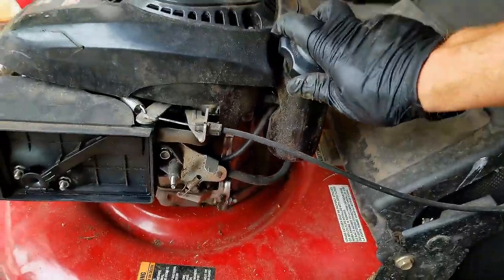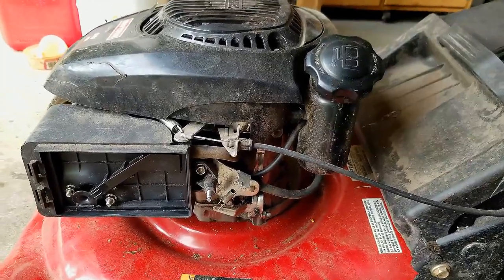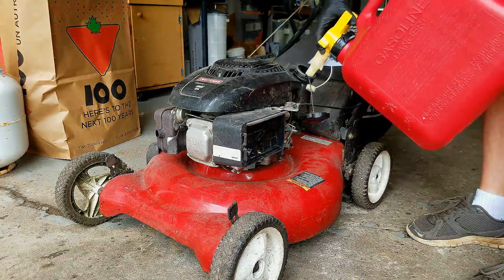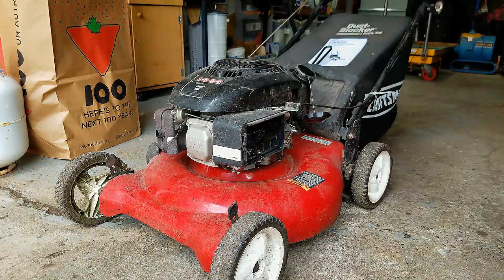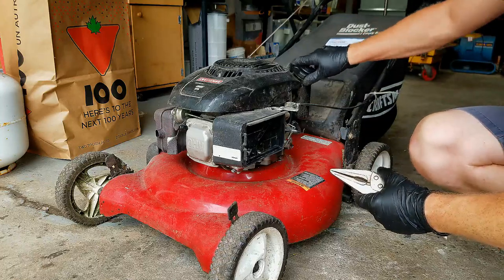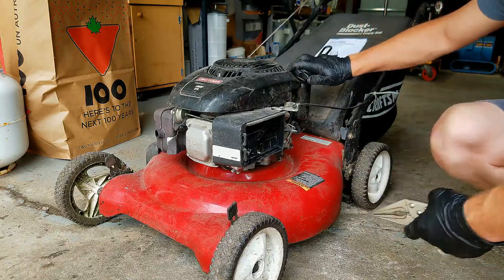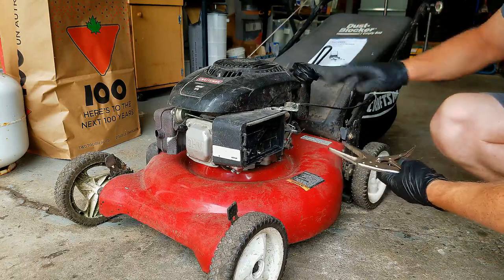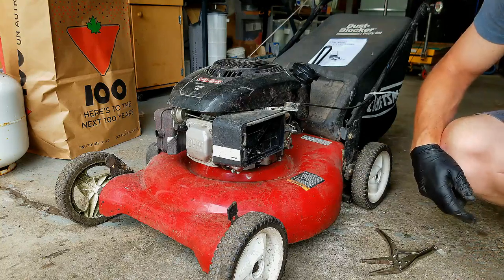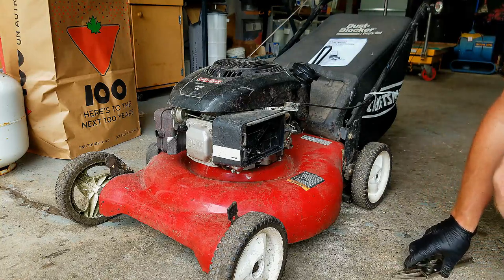What I'm going to do is actually try to put some fuel in this thing and see if we can duplicate the problem. I have some needle-nose vice grips here just to pinch off the fuel line if it does start leaking, because this thing does not have a fuel shutoff valve like a Honda would, for instance. So I'm going to let that settle into the carburetor for a few minutes and we'll come back and see if it's leaking.